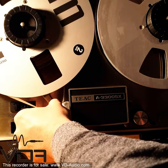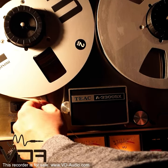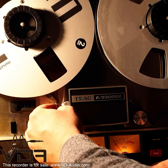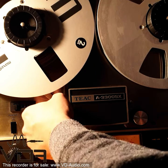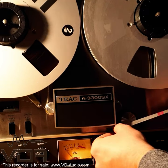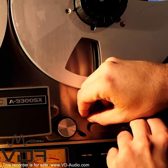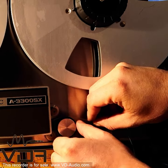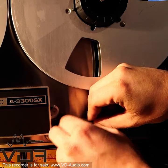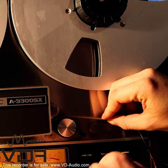This is a tension lever — we have to make sure the tape passes over this lever, which will maintain tension while the reel passes along the heads. This is perhaps the most important step: you have to make sure that the tape is actually between the rubber roller known as the pinch roller and the capstan. This is what drives the tape and regulates its speed.